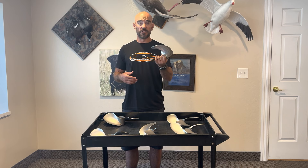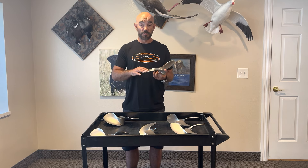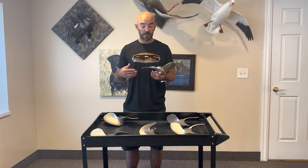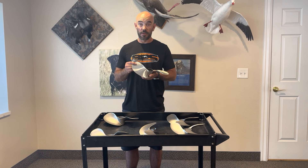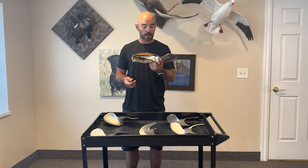The next is a new model — we call it our power blade. The power blade is actually 12 and three quarter by 10, so it's just a little bit more diameter than the big blade. The blades are quite a bit thinner, which means you can usually get more RPMs out of this prop. Compared to the big blade, this is probably going to be a little bit faster on the top end. The downside is it's a little bit thinner, so in really shallow sandy areas or rocks it tends to wear out a little bit faster. But that's what makes it faster. Great prop — very quick, pushes a load very well.